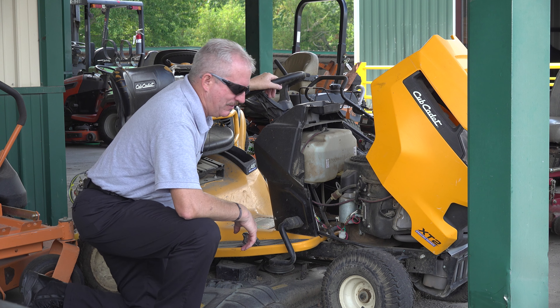We'll finish up here in just a minute. I want to thank our friends at Hagen's Outdoor Equipment for allowing us to come up — we always look for community partners who want to help keep our citizens safe, allowing us to look at these mowers and talk about things you can do to prevent a fire. The big building behind me is one of Hagen's warehouses — think about parking your mower inside that. Your mower is several thousand dollars, but your building is several more thousand dollars. Let that mower stay outside and cool off. Don't take a chance on damaging a prized piece of property. Leave it outside — 30 minutes is a good rule of thumb — then blow it off, getting all that debris off the deck, around the engine, and around the muffler. Be mindful where you park. Those mufflers can reach up to 600 degrees and put beside a combustible product, they will cause a fire. If you're having trouble — a short or an oil leak — have it looked at and repaired, leave it outside, and see what's going on with it. Hope this was helpful. Hope everyone has a great day. Thank you.